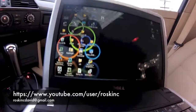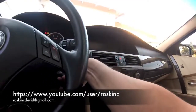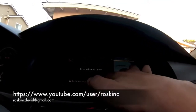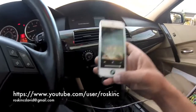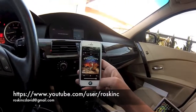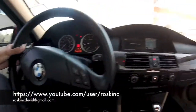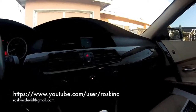We're done. Go ahead and exit that and turn off the car. Turn it on and we will now see — auxiliary is now added to the iDrive. Select auxiliary and it's going to say external audio source. Let's get our phone, iPad, iPod — whatever you use to play music, it's already plugged in. Press play. Volume controls work, steering wheel controls work. And that's all it takes for this auxiliary cable to function.